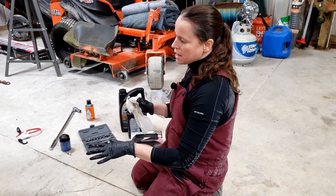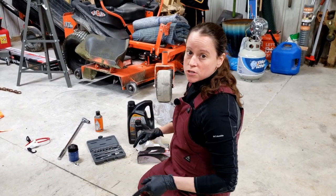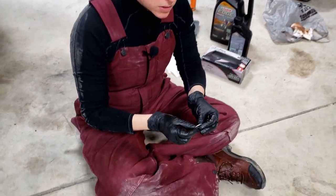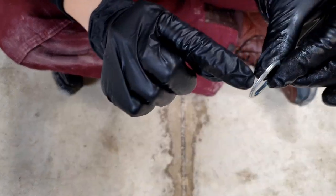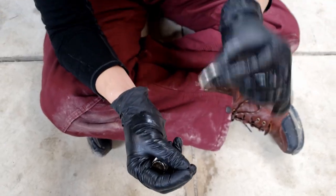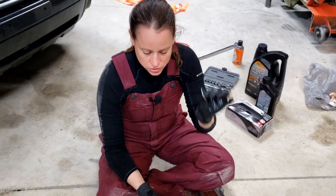Let the oil finish draining out, then put the bolt back in place and do the oil filter. Now that the oil is just doing a slow drip, it's time to put the bolt back on. The crush washer in a Subaru must be replaced every single time — you can see it looks like it has two layers of metal. When you tighten the bolt against the oil pan, it crushes. If you've got a different material for your washer, you may not have to replace it — on a Subaru, you do.